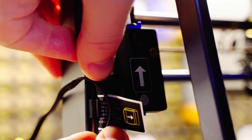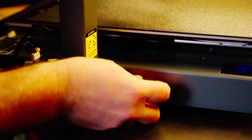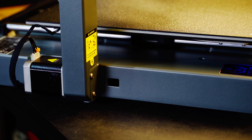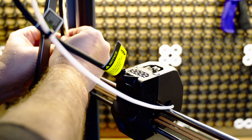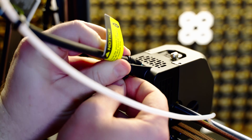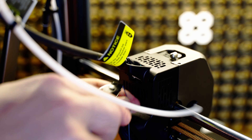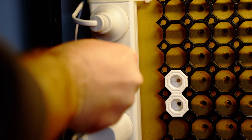From here we can start attaching all our cables and routing them along the printer. There are also some connectors: one for the filament run-out sensor, one for the left side stepper motor, and one for the rear stepper motor. Also on the side you need to make sure that the correct voltage is set — if you remove the sticker and look inside the small square area, you'll be able to see a switch. We can then put on some Bowden tube holders, which help run the cable alongside it for a cleaner look. There are some zip ties provided in the tool set, so we can tie down the cable connecting to the hotend, and there's also a small cover that goes on top. Then we connect the power cable, connect it to the wall outlet, and switch it on at the back.